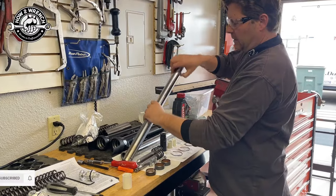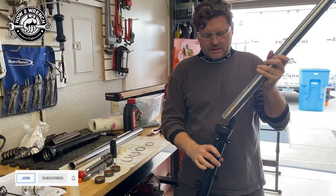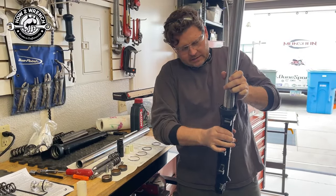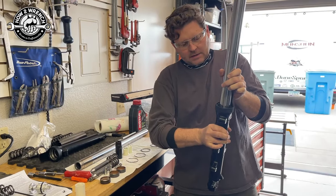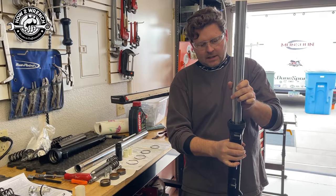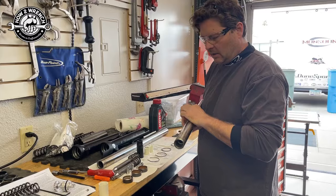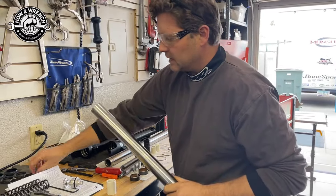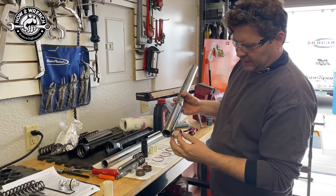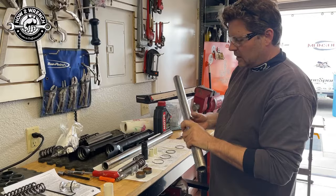One of the things you want to think about is that when these are assembled — we're just laying our parts out right now — every time you stop the motorcycle and grab that brake, there's binding. These two parts are going to bind with braking and with acceleration. To mitigate that, as the sliders go up and down, there are a couple of different bushings — upper and lower. So you've got one that rides on here and another that sits down here. This fork rides through both of them.